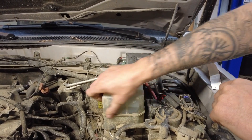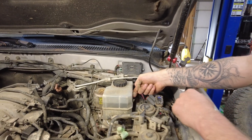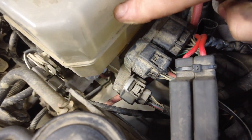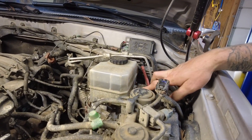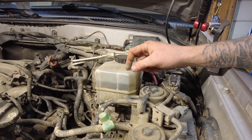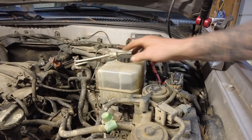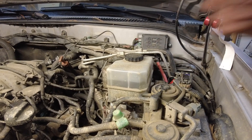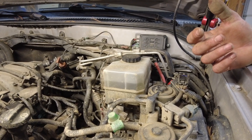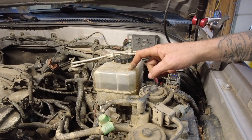The main thing we're concerned about with our brakes underneath the hood is our brake reservoir. On the side they're going to have a max and a min mark — it can be hard to see because normally they're clear. One trick is to take a flashlight and shine it right down on top; it'll highlight the brake fluid and you can shake it a little bit to see the level. If we run out of brake fluid and get any air in the brake system, it's not going to work correctly — you're going to get a soft pedal because we can't compress air like we can compress brake fluid.